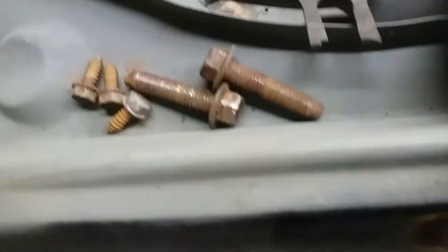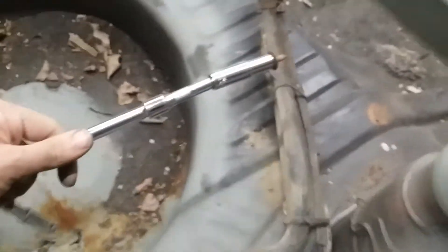They're only held in with three 10-millimeter bolts — two are from my tank, so don't worry about those. The remaining bolt holds the bracket up on the filler neck — it goes in like that — and that was a 10-millimeter as well. So a 10-millimeter socket wrench will get the filler tube off, and then you just need a 13 to get the tank down. It's really easy.